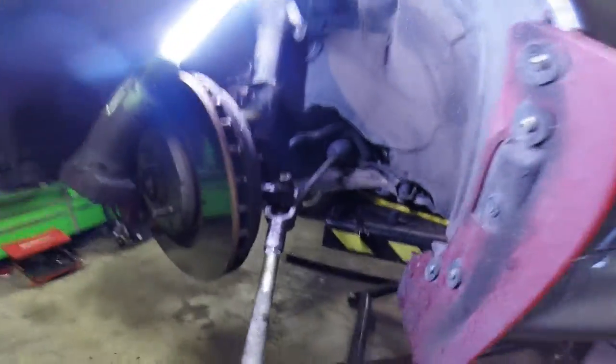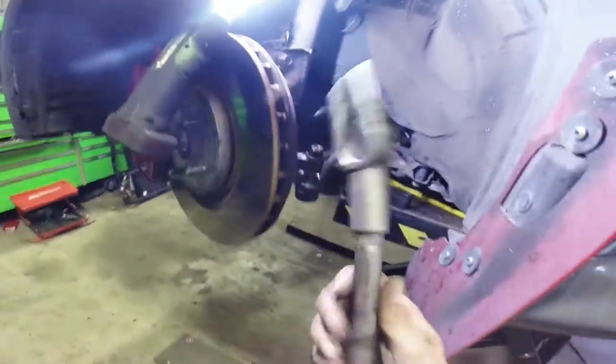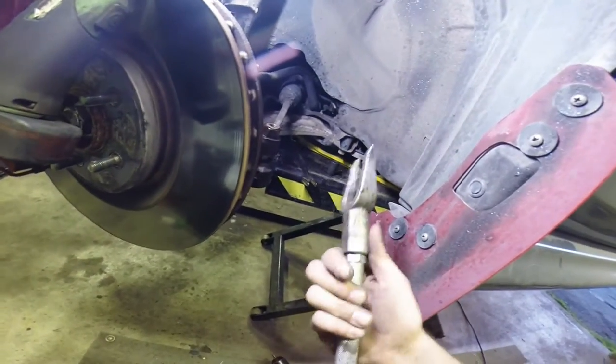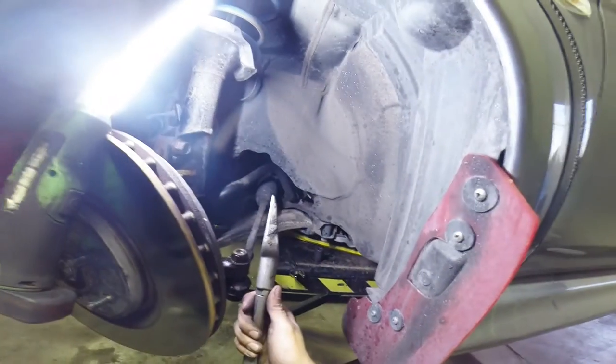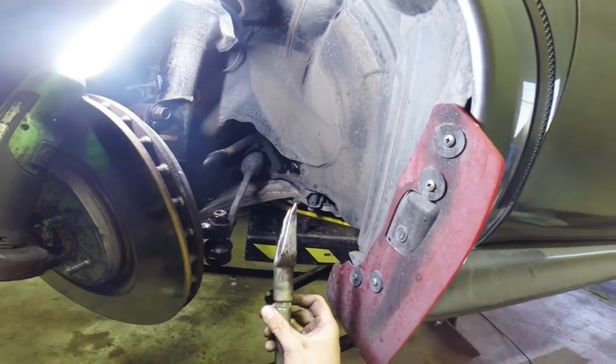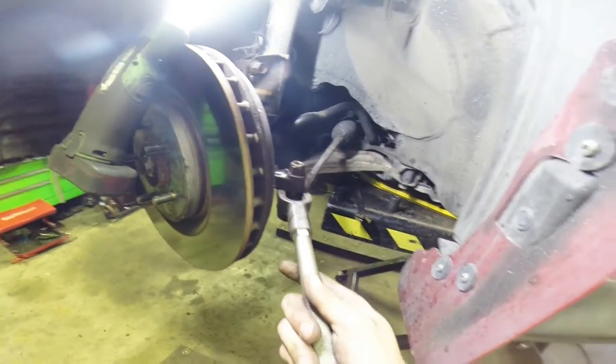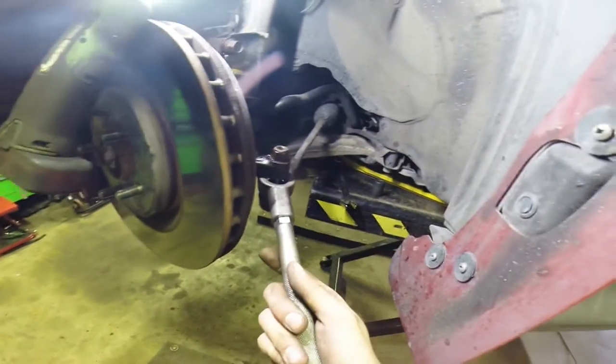We have our 19. Pickle fork — they have kits. This is like the medium size. There's a flat side and an angled side. Flat side goes down, angled side goes in. Essentially it started here and you just tap it, tap it, tap it, and it works its way in and pulls it down. You've got to be careful not to mark that boot there because I'm trying to save this as a used part.